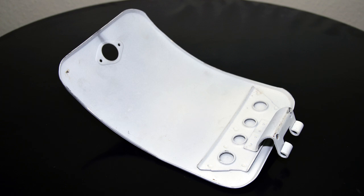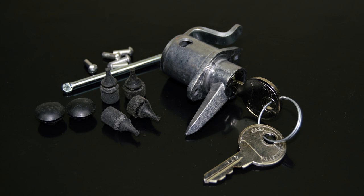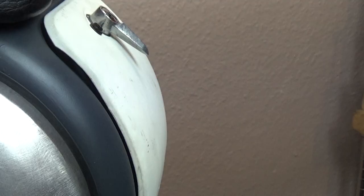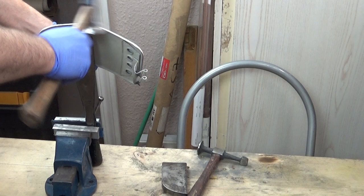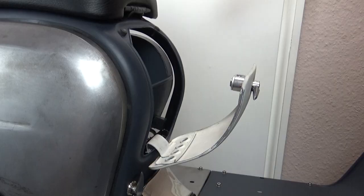Time to do something boring instead. Let's get this toolbox lid into place. It's from Lambretta Restorations, along with this CASA fitting kit and lock. I fitted the lock with some M3 bolts as a temporary measure, as opposed to the rivets that will be used once it's painted. At this point it became obvious the thing's from India — the build quality is awful and it's the usual bleeding bad fit. With it back off, I get grinding the correct shape into the lower half, and then stretching the lip on the edge to try and get a better fit. With all that carried out, you can see it's much better — again, not right, but better.